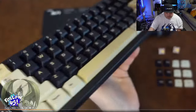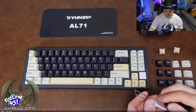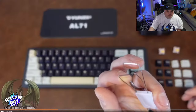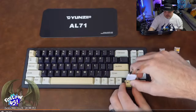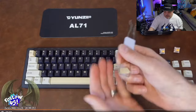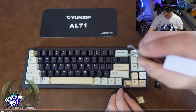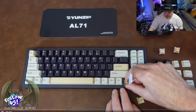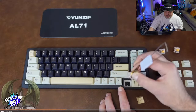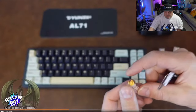It has a nice little angle to it. Let me show you how simple it is to pull off the keycaps and pull out the switches. Take your keycap puller, spread the arms, hover over the key, get underneath it, and pull it straight out. When you want to pull out a switch to clean or replace, take your switch puller, go on the north and south sides, pinch firmly, give it a little wiggle, and pull it straight out.